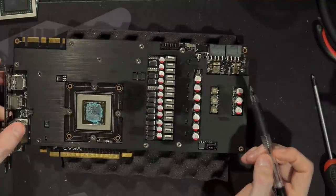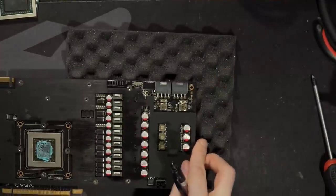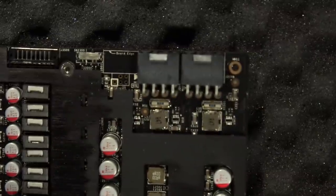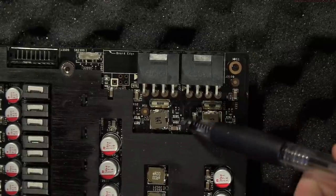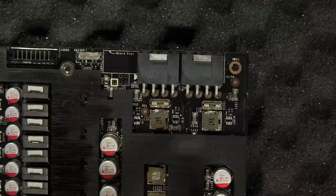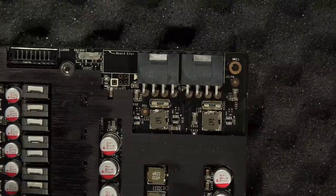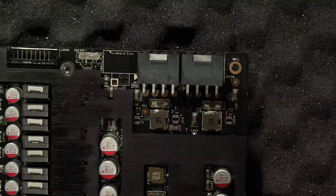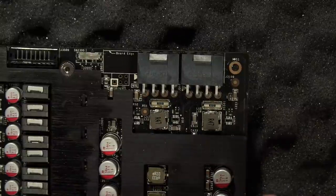The current monitoring thing — let's move the card over and zoom in. Normally on this PCB there'd be chips right here, here, and here. Mine doesn't have those chips because those chips are INA219s, which is like the little brother of the INA3221. On GPUs in the 500, 600, 700, and 900 series, if you literally just remove the current monitoring chip, the card doesn't have a power limit anymore.